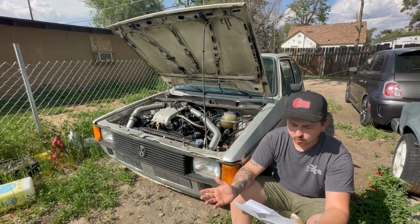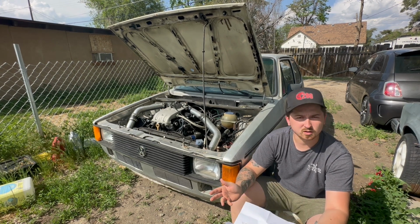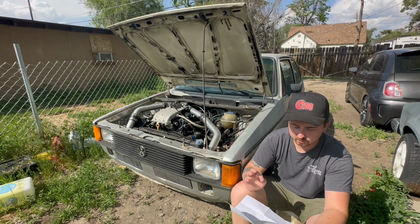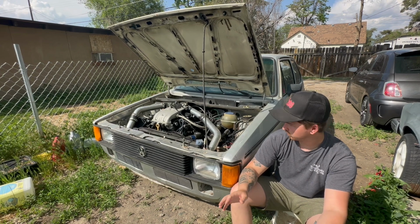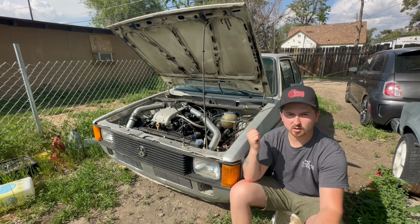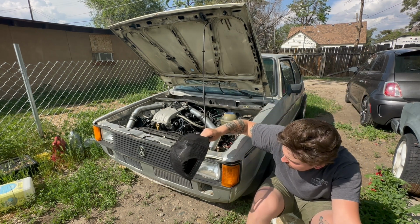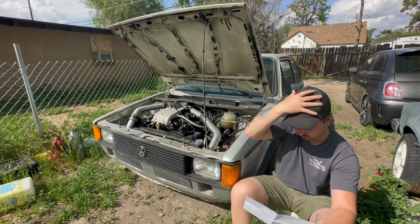If you are using the Mark III transmission, though, this has nothing to do with the fuel pump, this is just added intel, you will need to use all the shifting linkage from the Mark 1 Volkswagen. So everything that has to do with the linkage on this transmission all needs to come from the Mark 1. Anyway, that's a little better.